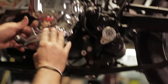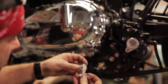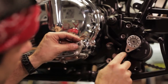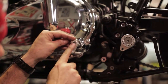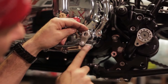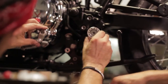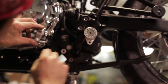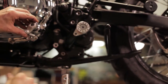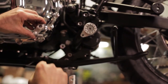We're going to take this stock piece off here, which we're not going to use anymore. We're going to use this replacement, and you always want to have this rosette — this gear shift arm — in the same position as the original. So for example, if this is down at 6 o'clock, so should this be. If you've got this at about 7 o'clock, so should that be. That will make for really easy shifting and movement.